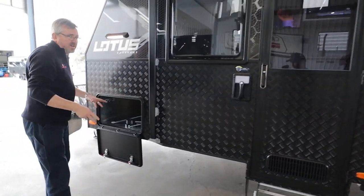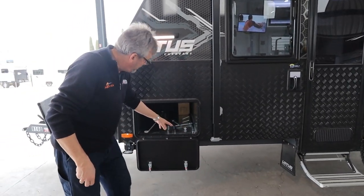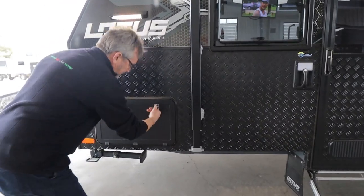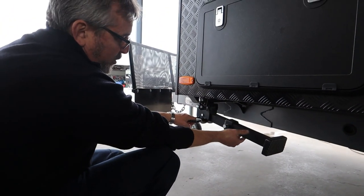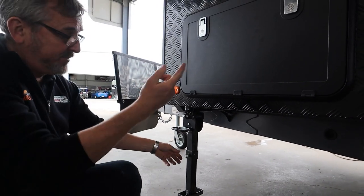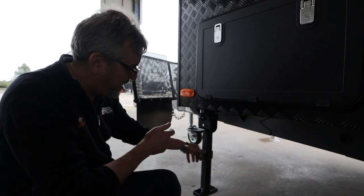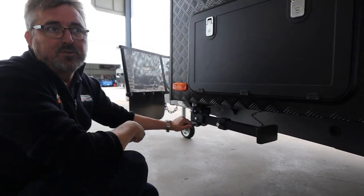Now we're back to the front side of the boot, which is where we got your awning hook out from. You get a stabiliser arm handle - I'll show you where that goes. Your wheel brace, spare hub cap. Under here are your stabiliser legs. If we take the weight, pull the handle, they drop down. Vertical is best. Then that bar drops onto the 19mm wheel socket - you can wind it down. It's there to stabilise, not jack up. If you're jacking up, use your jack to change your wheel. Make sure you pack them up for travel - you don't want them dragging on the ground.